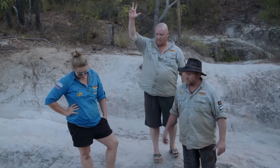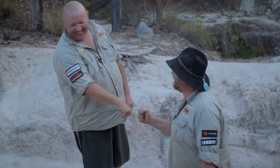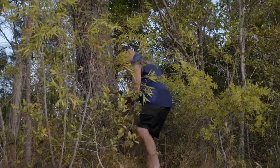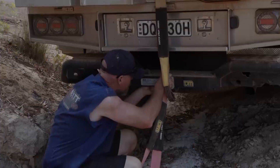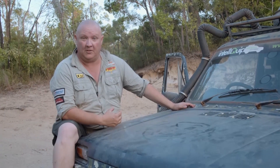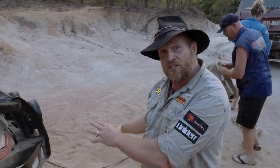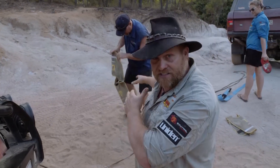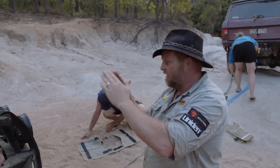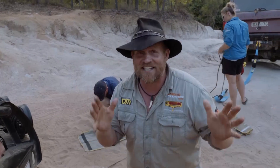Who wants to go first? Not me. I'll do it. Rock paper scissors — nah, I'm out. You're up, sport. You know, not too much fazes me in a four-wheel drive these days — I've been around for a while and I've done lots of silly stuff. But this is right up there. I've definitely got some butterflies in the stomach. We're going to use the recovery car as our anchor. What that's going to do is hold me on the winch and let me down as I need to go. Instead of me falling and maybe getting a lever reaction, it's going to hold me back. Then I'm going to slide down and off I go. Hopefully it's going to be as easy as that. Fingers crossed.